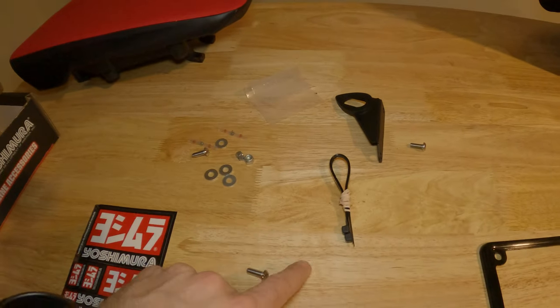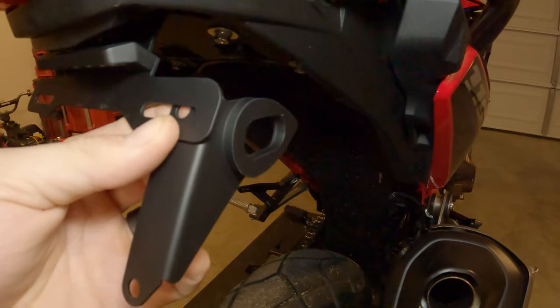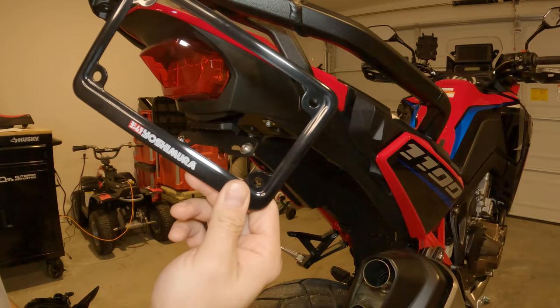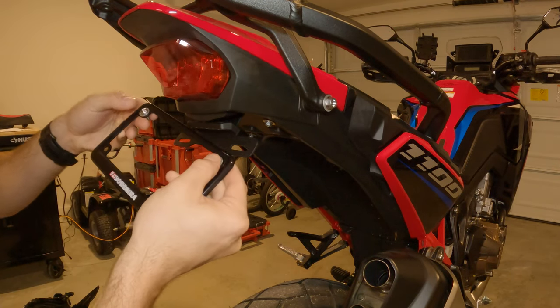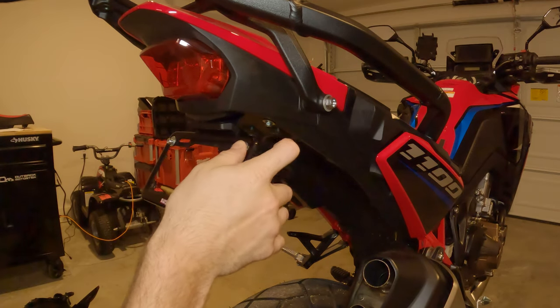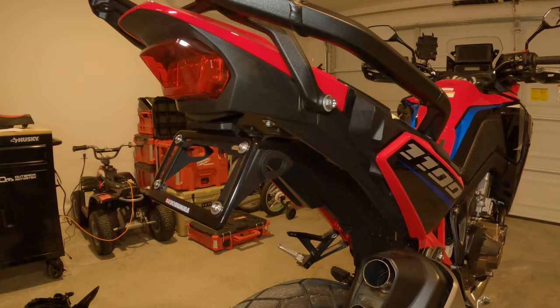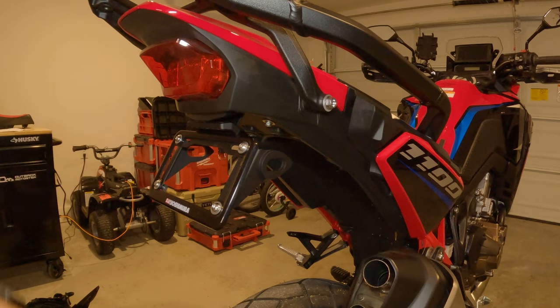You're going to get a bolt, a nut, and a washer — that's a four-millimeter allen and a ten-millimeter. This is what your tail light attaches to, and that's going to be the frame. Go ahead and put the tag holder on here because that's what kind of holds it square — it goes in like that. Four-millimeter allen, this is the right side, this part goes out. Snug that by hand, same thing on the other side and on the bottom. Tie these down with a four-millimeter allen and a ten-millimeter on the back.